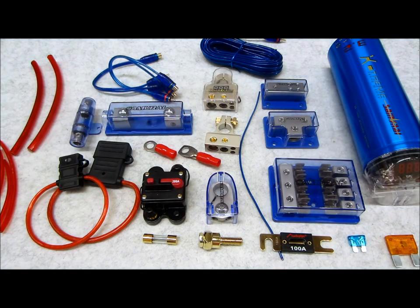If your amplifiers will be powering dissimilar speakers like subs, mids, tweeters, etc., then you can use an electronic crossover to split and filter the signal going to each amplifier. Sub-bass frequencies would be sent to the subwoofer amp, and high-pass signals would be sent to the other amplifiers. A crossover will have built-in line drivers which will increase the signal voltage of the RCA cables, and this can help lower the noise of the system as well. I don't know if you knew that, but it does work, and I'm a huge fan of line drivers and signal processors, but in today's world where everything is so digital, most of these radios already have all the stuff built into them. But consider it if you're doing an esoteric system and you really have some real wild stuff going on, a lot of components, a lot of amplification going on, you might want to invest into a signal processor.